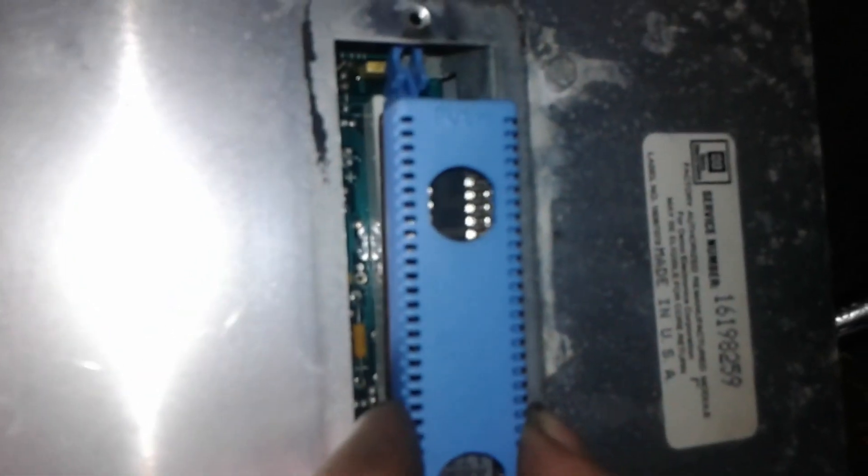There's a little bit of a wire mess up in here, but it slides right past that — you don't have to deal with any of that. And then these two bolts right here take off the cover and allow you access to the PROM. So if you're replacing your PROM, or you've got a programmer like I've got, that's where you're plugging in. Once you get that cover off, there's a tab on this side and a tab on this side that just pushes out of the way. Make sure that you keep the orientation proper when you put it back in.